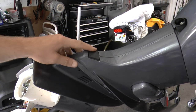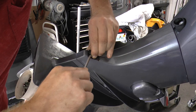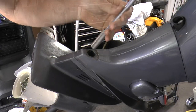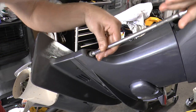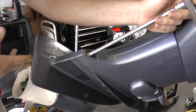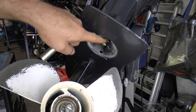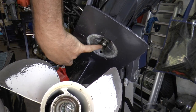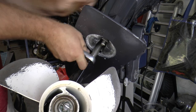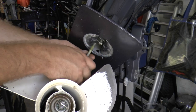Located on your midsection, you have a rubber piece that you need to remove — sometimes you can get it with your fingers, if not use a flathead screwdriver to pry it out. Down here we're going to remove a bolt. Using a 12mm socket, remove the bolt which holds the zinc trim tab. Once you remove this trim tab, there is a hidden bolt holding the midsection together. Once you unscrew the bolt completely, the zinc will come right out, and right here is that hidden bolt — you also need a 12mm socket to remove it.